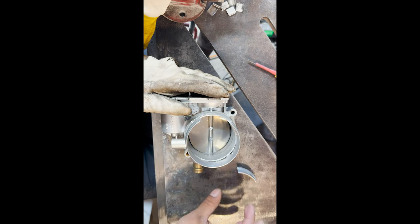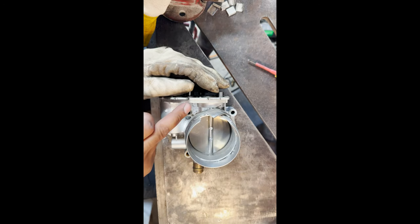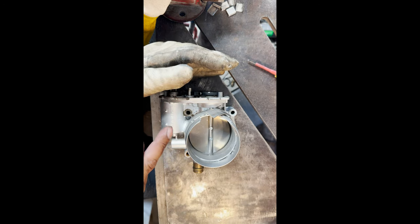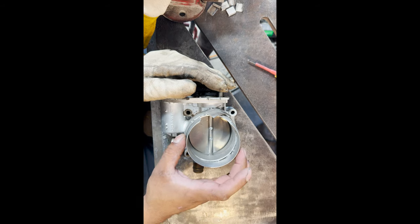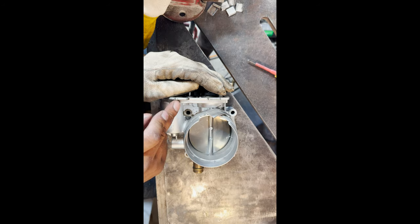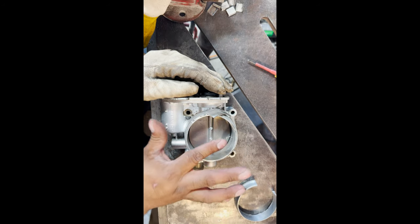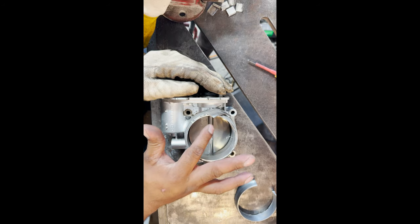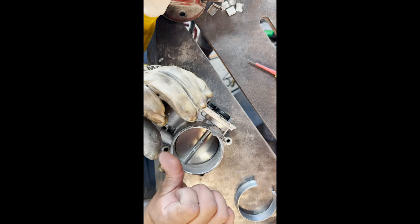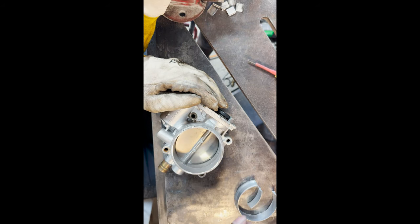So what we did was we cut off our top flange. Unfortunately the grinder does not reach on this side because then you have the risk of nicking your flange where the plastic covers. So what I do is just cut off as much as I can without the cutoff wheel hitting my flange. And then you can just wiggle this off until it cracks off. Then you can hit the cutoff wheel on the inside of the flange. Just give yourself enough of a little groove, and you should just be able to crack it loose with your fingers as you guys saw in the time lapse. So once you guys have all that, you're good to go.